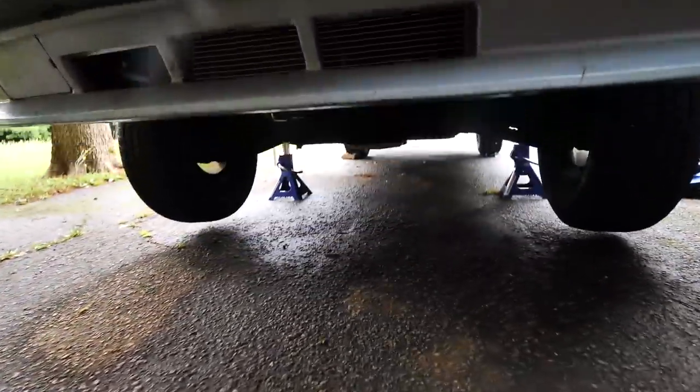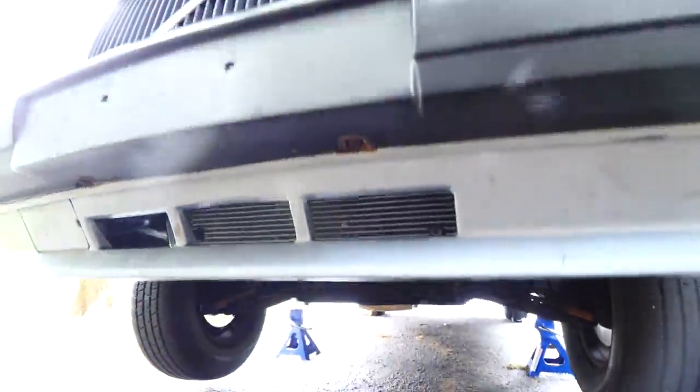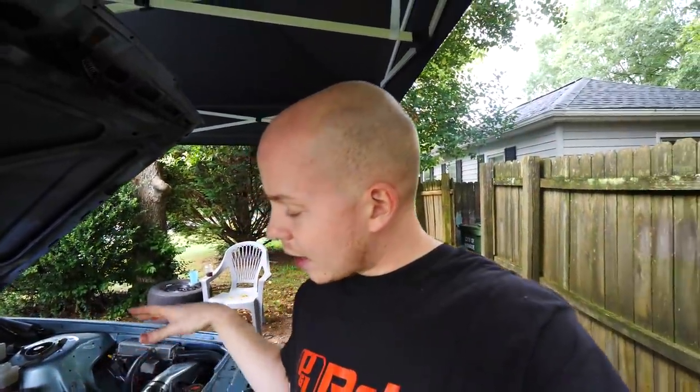The new crank pulley is installed, but we still have to pin it. The crank pulleys on these motors are just pressed on, and sometimes when you're making big power they will slip. So you drill a hole through the pulley and the crank, then put two pins in it. The crank has holes from the last pulley, but now we have to put new holes in this pulley — I pretty much just have to drill into my six-thousand-dollar motor and my six-hundred-dollar crank pulley in order for it to work.